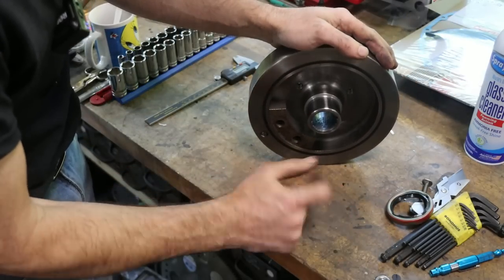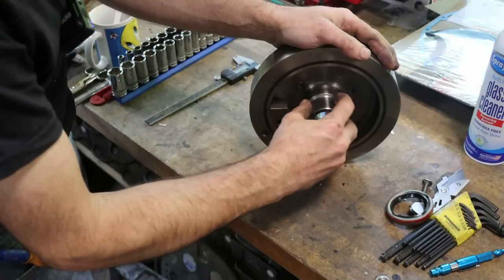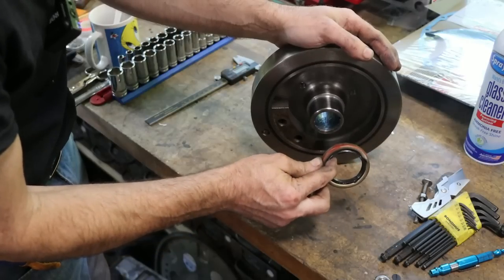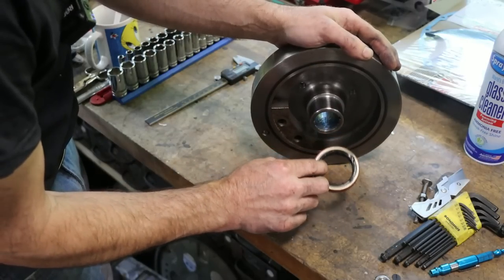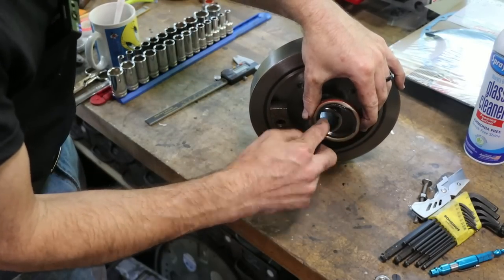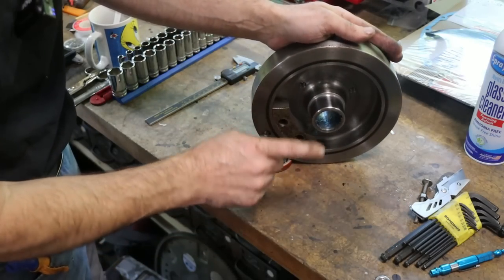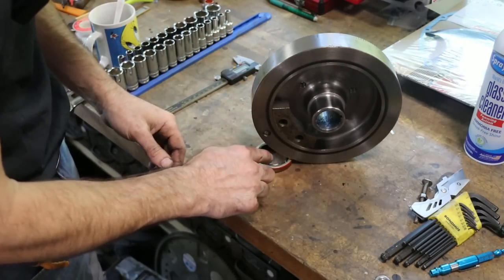So, what do I think happened? I think it was the coating that was on this from the factory. It wasn't because of lack of lubrication on my original assembly, because I put assembly lube on my gasket before I put it together. So that's what I think happened: that coating broke down and burned up that gasket.